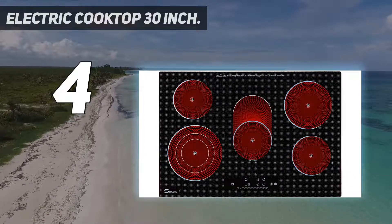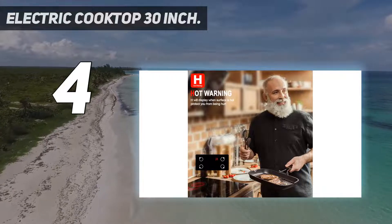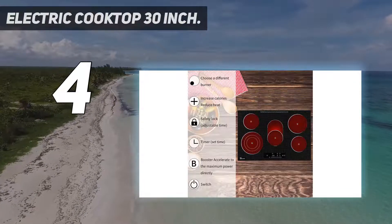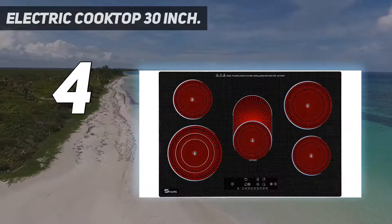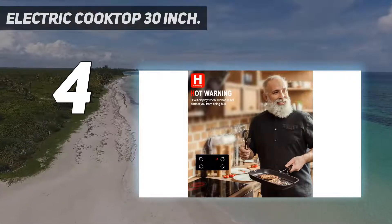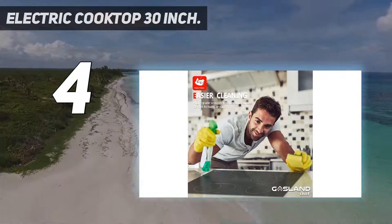With the safety features this electric stovetop offers, it can be beneficial for kitchens of all sizes, especially households with children. The sensors are easy to control, which helps your precision when picking your desired temperature. The 5.4-inch/9.1-inch double cooking zone has a maximum 1000W/2200W power, the two 6.5-inch round cooking zones have a maximum 1200W power, and the 6.5-inch/10.6-inch double cooking zone has a maximum 1100W/2000W power. The digital sensor touch control has 9 power levels for precision, switching from boil to simmer, and helps you control the electric cooker heating accurately.